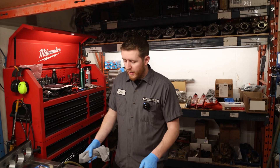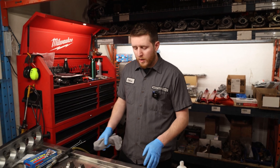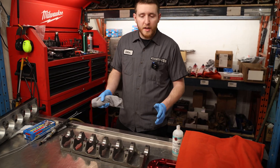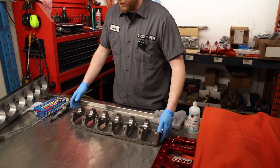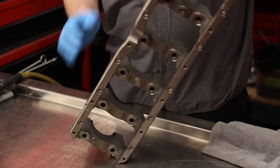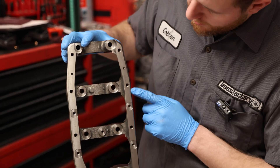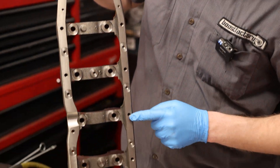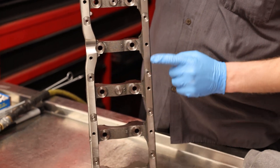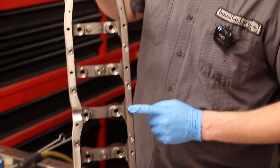Now that you've gone ahead and cleaned off the surfaces with your scotch brite, go ahead and wipe it clean again. Some areas of notable concern: because this girdle is now machined for the brace, there are blind holes here, so you have to go through and blow compressed air through each one of these new holes that don't go all the way through, just so there's no debris behind there when you go to tighten it down.